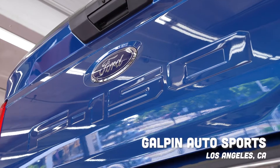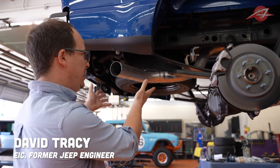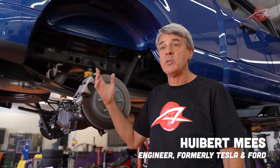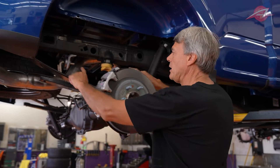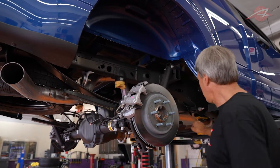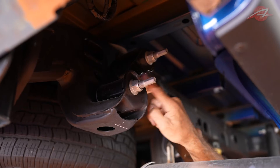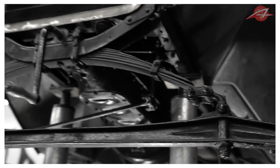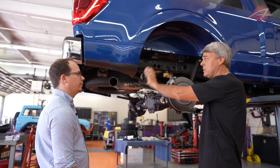This is the base truck, so we have just a really simple suspension that you'd see in a truck from the 1930s. For decades this design has been in trucks and cars since the beginning. It's called a Hotchkiss design, and what you have here is two leaf springs that run fore-aft in the vehicle. It is connected directly to the frame on the front and connected via a shackle on the rear — kind of like the shackles on the Model T — but in this case there's only one shackle and it's at the rear end of the spring.